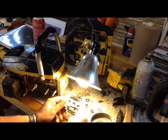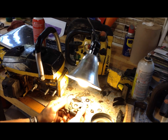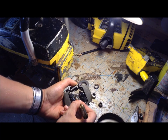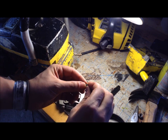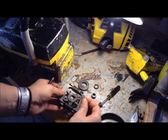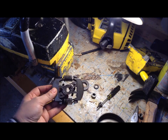But when I took this clutch off, it has one of those removable flywheel keys. I wanted to show you how much better that system is. So inside the clutch you have that little key — with a screwdriver you could easily pop it out. There's the key. This one's in really good shape; I could put it back in, but if it wasn't, you could just buy a new part and slide it right back in. Way easier than sanding and filing and making your own key.